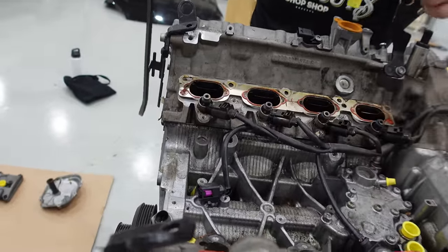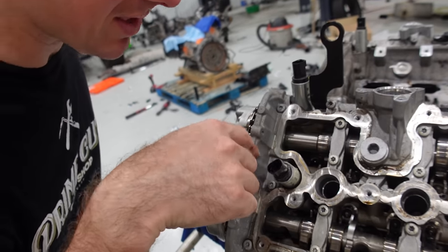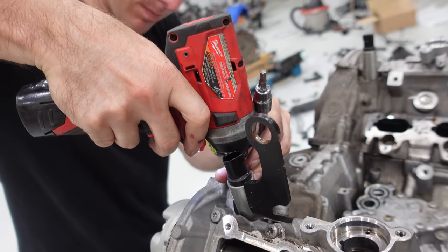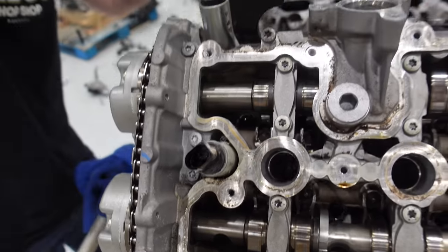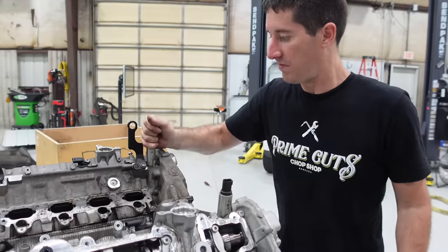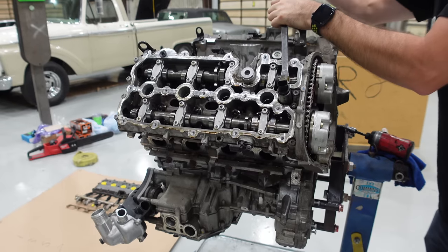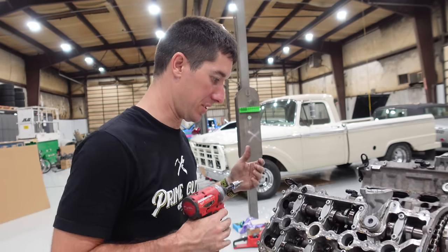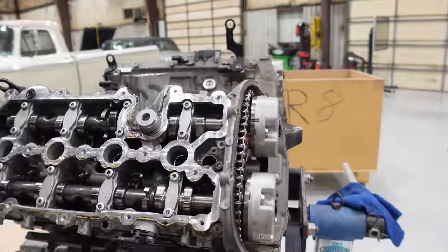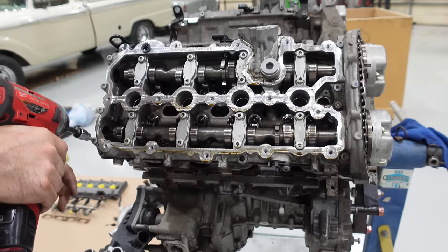None of the injectors came out on this one — that is unfortunate. There is no way to get a Torx driver in there. These are T20s down in the cam actuators; you can get to the top ones, no problem, but you cannot get to the lower one. This one's been replaced and they used an Allen because of accessibility reasons. We can finally pull our cam actuators. We'll dump some oil in here and pull all these out.